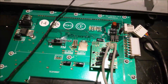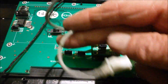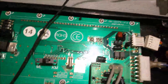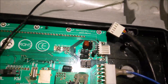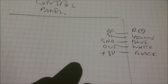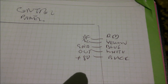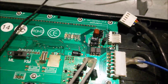For now I'm going to stick with trying to video this on the phone. The sum total of all connections to the control panel are the two from the heart rate sensors, the heart rate sensor board, and then this single five-way Molex-type connector. Fortunately there is a little legend here which I've drawn out to make it a bit clearer. Top two are labeled AC, the middle one is labeled ground, the next one down is labeled out, and the next one below that is plus 8V — though it's not quite clear. The wire colors are: red at top, yellow, blue for ground, white for out, black for the bottom one.